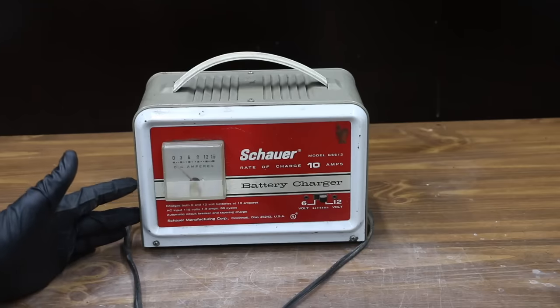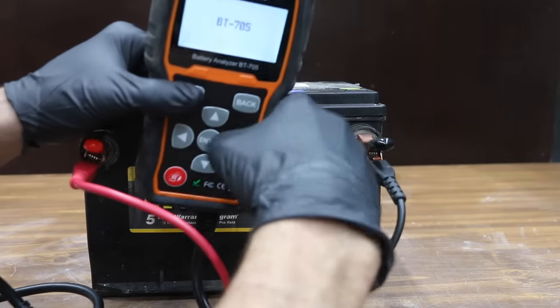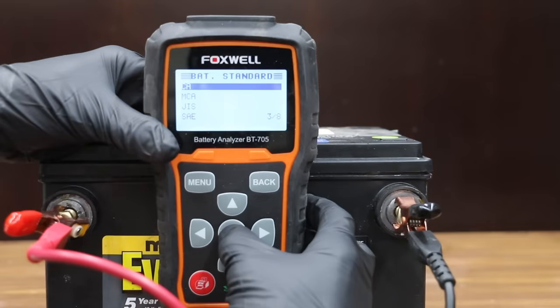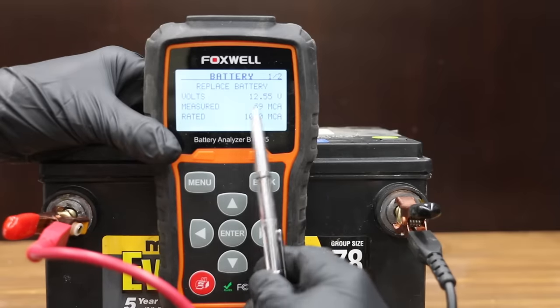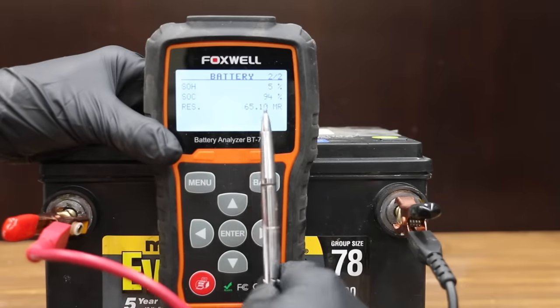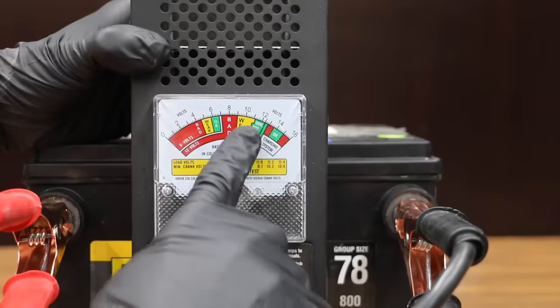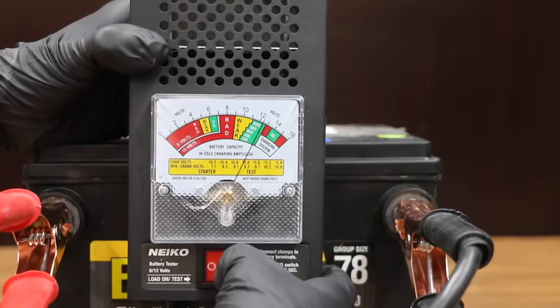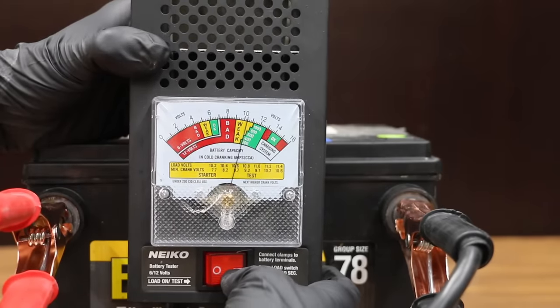I'll place the battery on a charger and allow the battery to cool for several hours. Battery 3 has been on the charger overnight and is completely cooled down. Before adding Epsom salt and zapping the battery with the welder, the battery was at 599 amps. The battery is now at 59 amps, and there's a lot of internal resistance. The Epsom salt might be throwing off the calculations of the electronic tester, so let's use the load tester. The battery started off at around 600 amps and gradually dropped to just over 200. So unfortunately, the Epsom salt did not fix the problem.